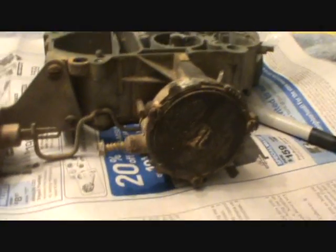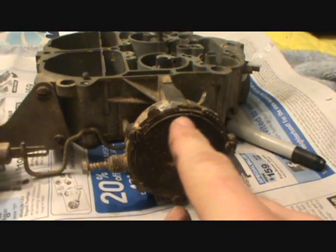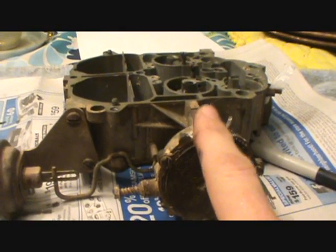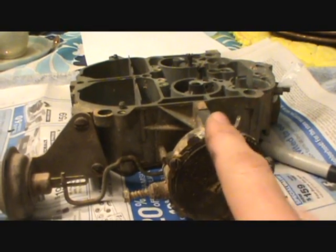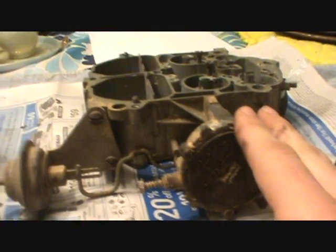So what a hot air choke does is it unwinds the spring in here, which I'm about to show you, because of hot air. Of course, the longer the engine runs, it warms up, and any choke has to have some method to warm it up to unload it. So I'm going to briefly set this aside here. I'm covering a lot of things here. I'm trying to remember. I don't like to edit videos together, so